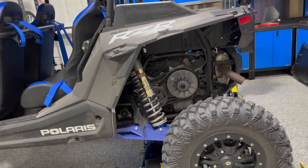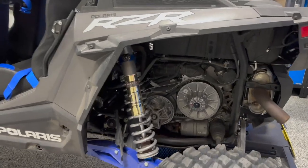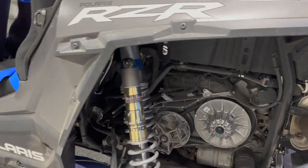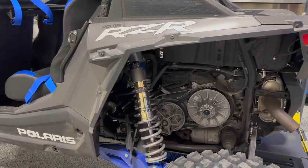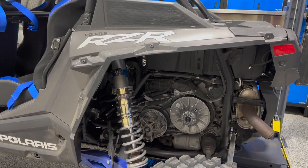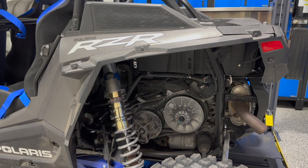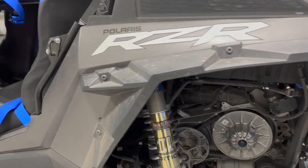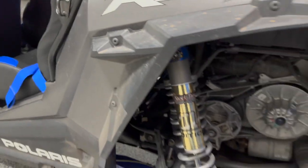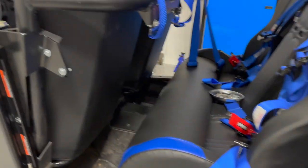The oil filters are in a weird place — at an upward angle on the back side of the engine facing the back seats. The one that was on it was a Polaris oil filter and it was finger-tight, maybe less than that. There was oil residue all around it — the engine had been getting dirty. It doesn't look like oil was flowing out heavily but there was definitely some coming out. Got all that done, ran some wire down the middle, and then put in the console, the new battery, and the seats.